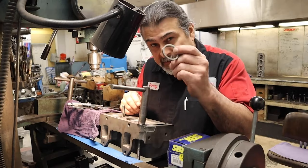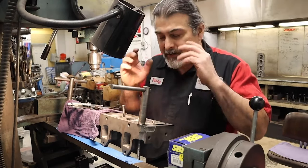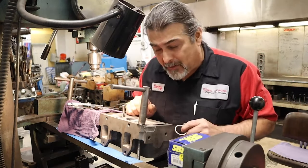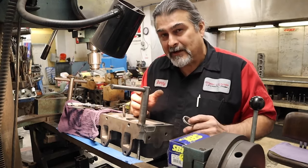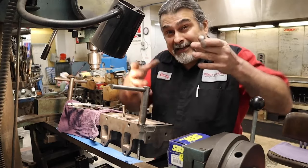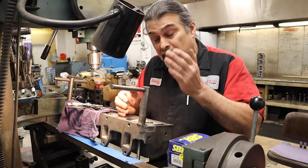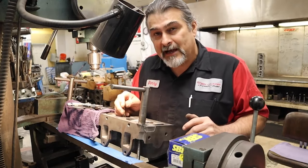Even manufacturers in aluminum heads are dropping seats because they don't have enough press fit. So what do you do? You freeze the seat and you heat the cylinder head. I have an oven — I put the head in the oven at 300 degrees, maybe 275-300. If you're only doing one seat, take a torch and just warm up the area around it. It's aluminum, it expands really quickly. A frozen seat goes right in and you're not taking any aluminum out. It's really delicate. It goes in on a fresh bore, it's expanded, the seat is shrunk — let it sit in. You're never going to have a problem again. You don't need to freeze the seat or preheat a cast iron head — four thousandths press fit, not a problem.